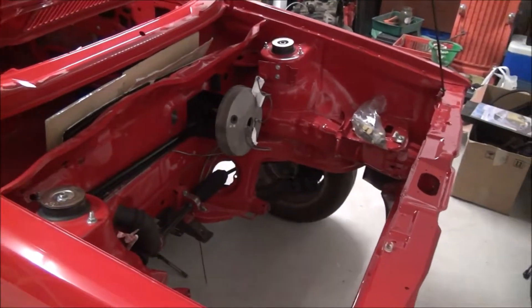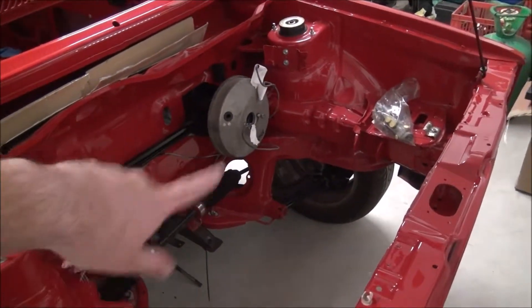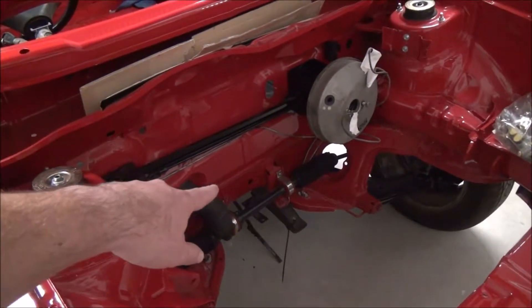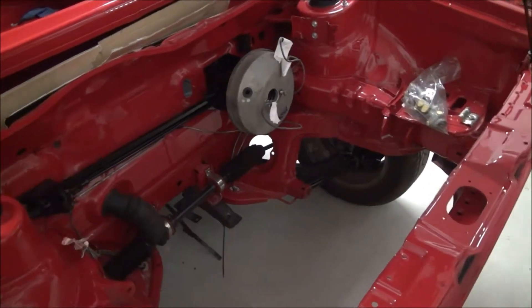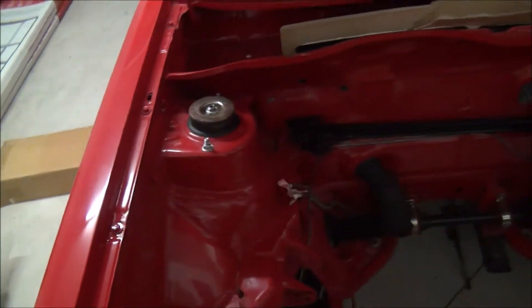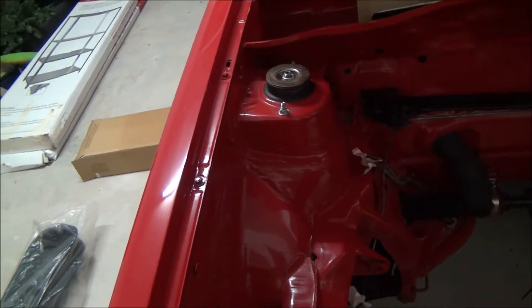This is the start, and the reason I want to start doing the powder coating is because I want to start cleaning up the engine, cleaning up the gearbox, and putting it all back together in the engine bay. I just want to get the engine and gearbox in so that's done and dusted. Get the strut brace in — it's better when the engine is in before doing the strut brace. That lower gearbox mount over there needs to come off the car. There'll be a polyurethane bush that sits on top, also red, like all the other red bushes. I need to clean up the engine bay and get the bushes and rubber grommets in. The rubber grommets that go here I just cannot find — I'm going to have to import them, or get some foam rubber and make my own.